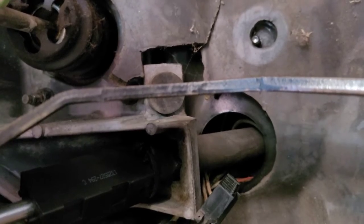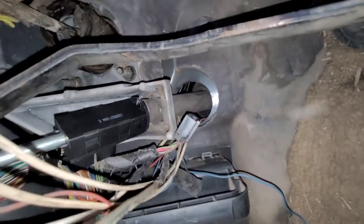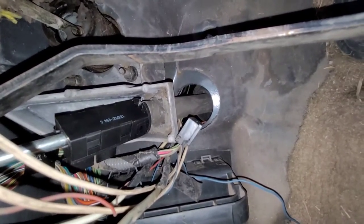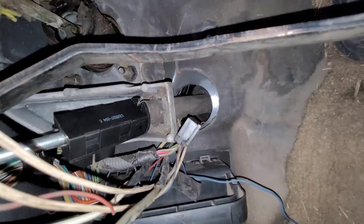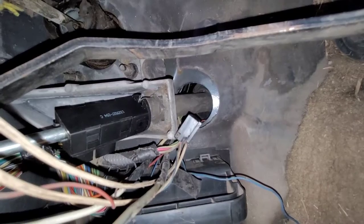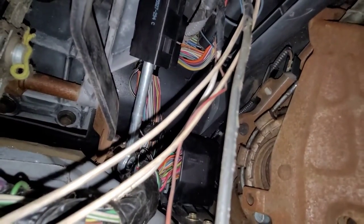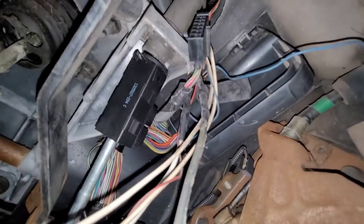So I got that part in place. You can see it's in there — it's very tight. I got the cover back on. There's a step on the rod itself that catches in that white plastic piece that slides — that's basically what locks it down in place. So now I'm going to hook the wiring harness up to it, and then go up to the other end and get that bushing installed. That goes all the way up in there — very difficult to see, but it's going to be all by feel.